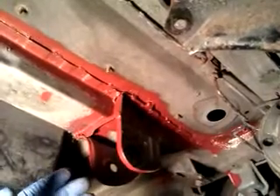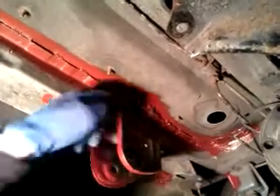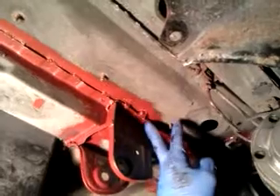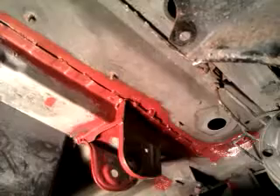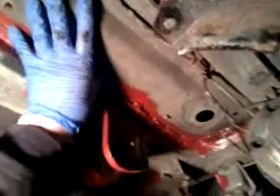I've additionally attached the front diff mounting to the floor. It's attached to the crossmember anyway, and there's a spot rivet that goes all the way through from the floor to the top of the diff mounting. In addition to that, I've welded here and here — they look pretty poor quality welds, but trust me they have penetrated. There were marks on the inside of the floor showing the good penetration.